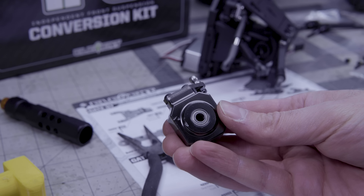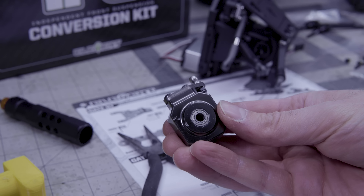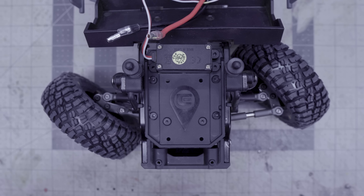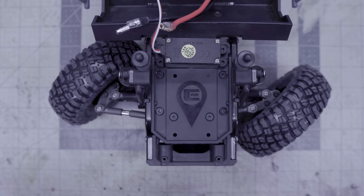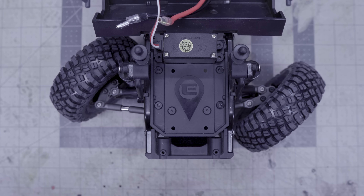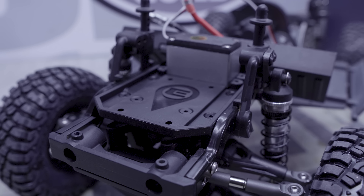Because Element is a strong supporter of the aftermarket, they made sure that their new front steering knuckles weren't going to affect any aftermarket knuckles that might exist. I was able to install my SSD RC weighted knuckles without any trouble whatsoever. I did have to enlarge some of the holes a little bit to make room for the new ball mounts, but otherwise it was a really easy step to add my own aftermarket parts. You do get a metal servo horn with this conversion kit, which is a nice added touch. The steering doesn't seem to have been affected — you still get a ton of steering throw on this truck, which is fantastic. All of the linkages are five millimeter steel using the gray plastic rod ends, so they should hold up to a fair bit of abuse.